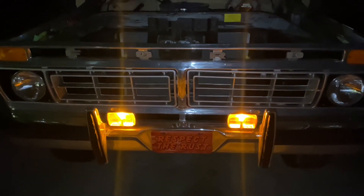You see here, they lit up just like they're supposed to. Well, that's all there is to it — it turned out really well. It was real simple to wire the switch up. That's how you wire up one of those lighted switches, and it's a nice feature because now, whenever the switch is turned on, it'll light up to let you know that it's on.